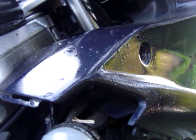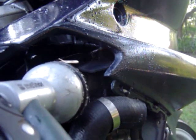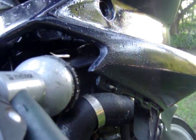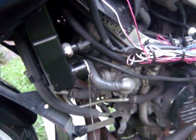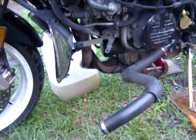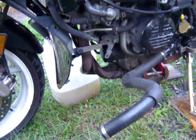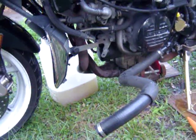You can also do it the other way — see that hole right there in the radiator? Just run it right through. I'll run over to the other side and show you — there it is coming out as nice clean water. Now I know it's flushed. It's going through the engine, through the upper heads, through the water pump, through the thermostat, and now through the radiator.